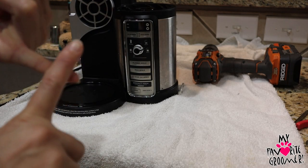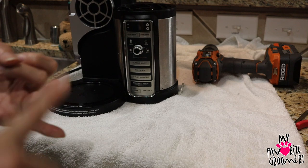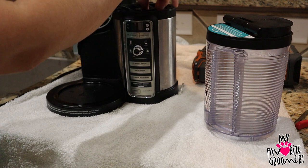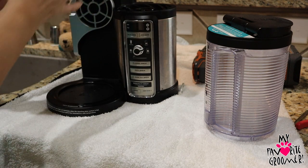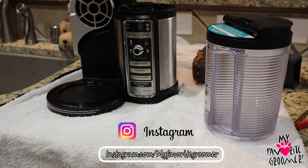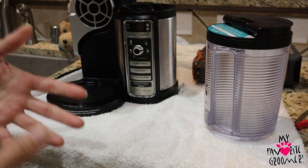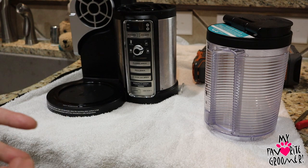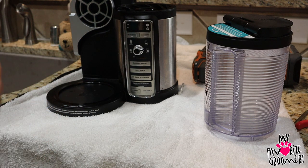Clean out the spout for water and all the soap scum. Clean out the bottom of your water tank. Clean out the top of this little water drip. Make sure all this is clean — everything that allows water to flow through. Then on top of that, you're going to open up the bottom of your coffee maker and blow through the hoses. One hose in particular, but you might have to do both since there are two hoses back there, depending on the coffee maker.